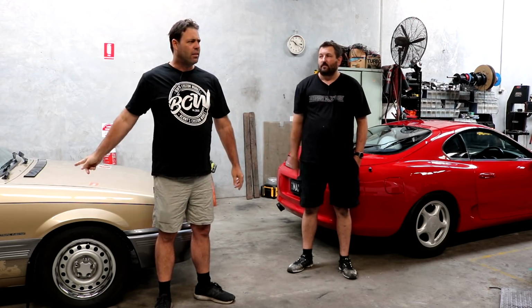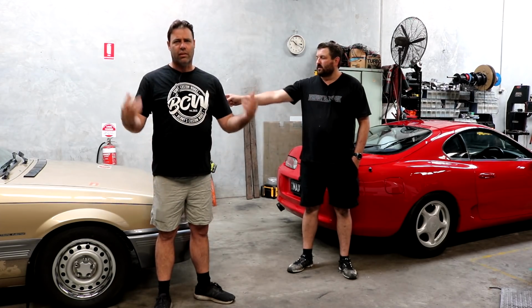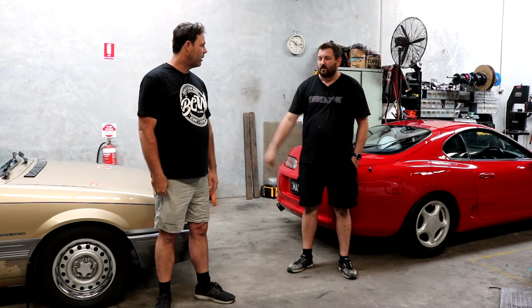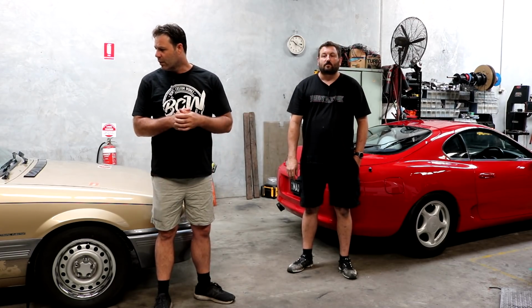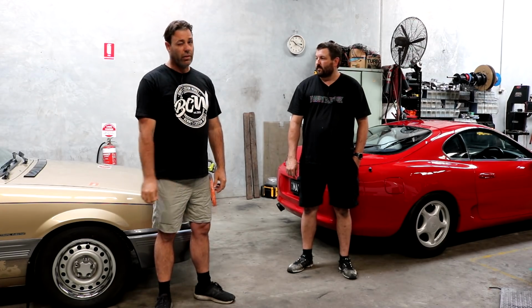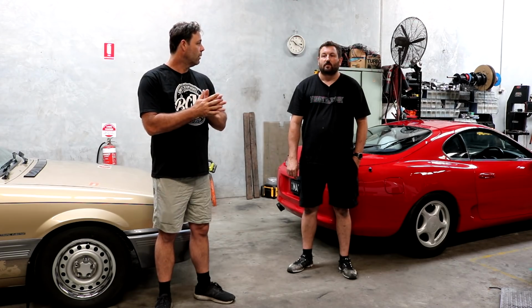I haven't actually raced this thing since I snapped the axle, so I don't know. I've done 260s and the second one snapped the axle, so I don't know how it's going to work. There's a link cable on there. It's got 31 spline billet axles now and Harrop TrueTrac center. And we hooked up the trans brake rather than the foot brake last time, which I was leaving on. So we'll push the button on that and hopefully not kill it. Shouldn't break. Should be right.